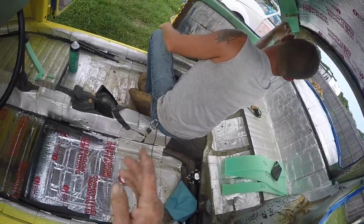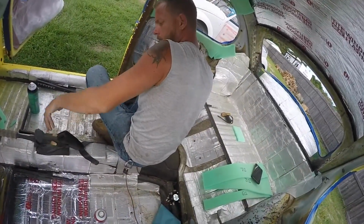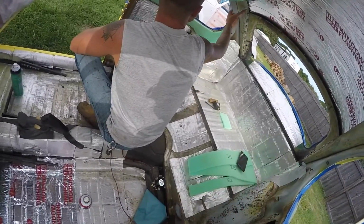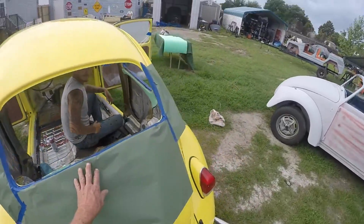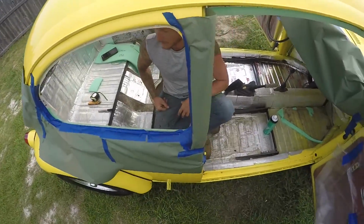And you know, when you spray the adhesive on the foam and then put it on the surface that you're going to apply it to, then wait 3 to 5 minutes or so until the bubbles pop, or you can take your finger and you'll feel the hairs come off and it's tacky then. You see, it's kind of breezy, so it's better to mask more if you're in an environment like we are, not inside a building.